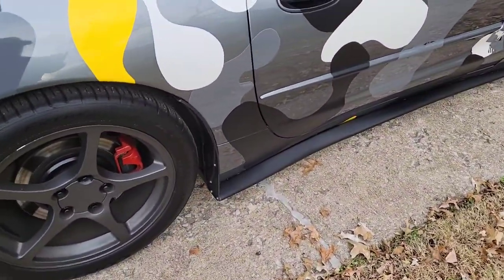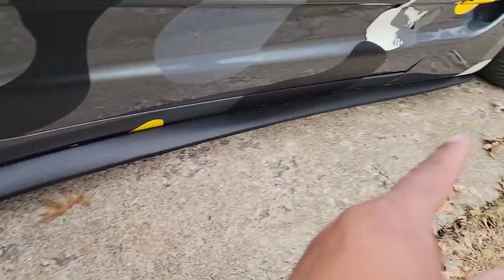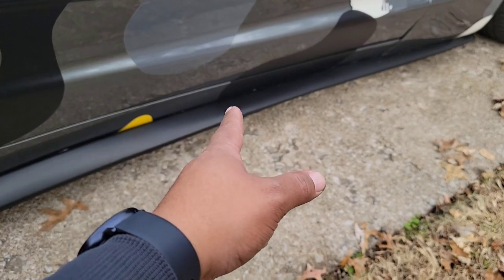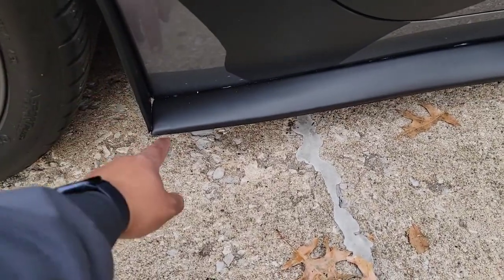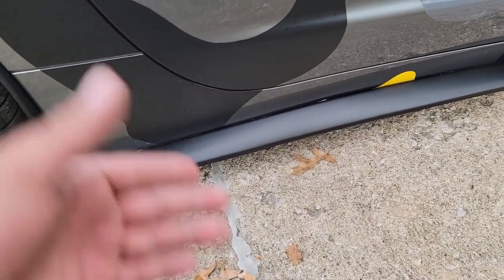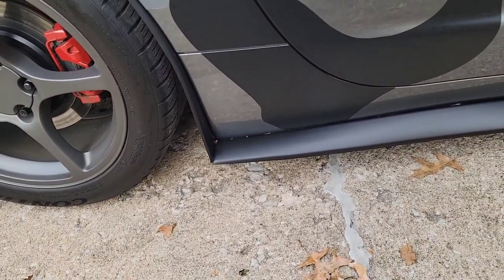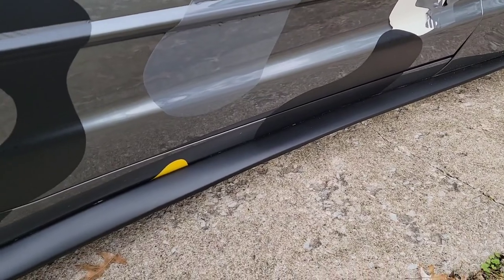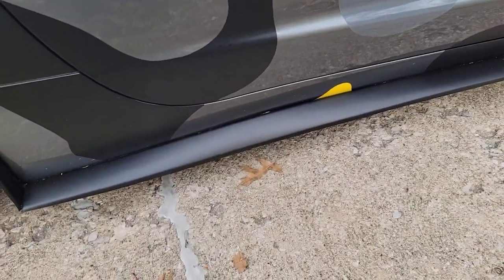You do have to do a little bit of adjustments and movement. When I've done it, I put one screw here and one in the front, and then worked my way back. Then once I got to about the middle of the door, I stopped and put on the mudflap and attached it to the side skirt, and then put those three in after. Because it pulls the side skirt down really far, and it'll be hard to put the mudflap in once you do that. So it's easier to start there, work your way back, go halfway down, put your mudflap on, and then pull the rest of it in — it'll suck itself in.